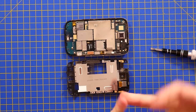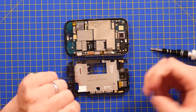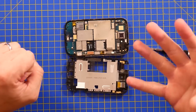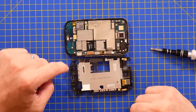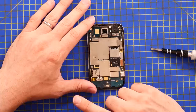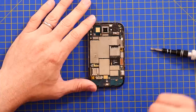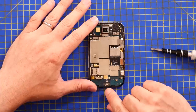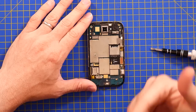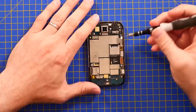Obviously GSM for mobile connectivity, and also AGPS — assisted GPS. So you had at least four or five antennas in there: one, two, three-ish, four identified already. On the back we've got a load of RF shielding, which is weird because you don't tend to see that anymore on phones. Although, I'm pretty sure on the Nexus 5 we actually had a sort of copper film taped on the back, which must have been serving a similar purpose.